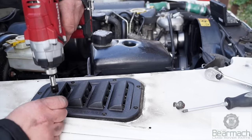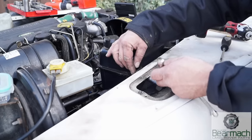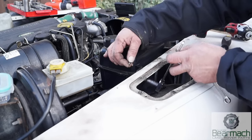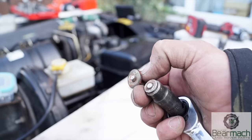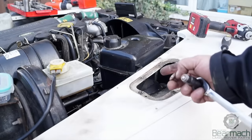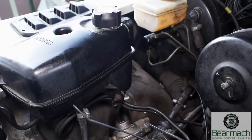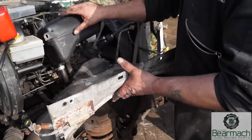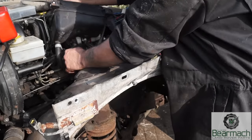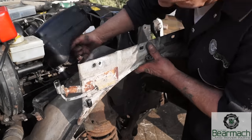This is a good access hole to get to the nuts and bolts holding the header tank on. These were seized and I had to snap them off. They're quite easy to do because they're M6 - not exactly too thick - so a couple of spanners will do it, but I've used a socket and a spanner to snap them off. Just remember the header tank has a nut and a bolt on the back end. This bracket is a bit of a pain unless you undo it from the bottom of the inner wing, as it's going to get in the way when taking the inner wing out.